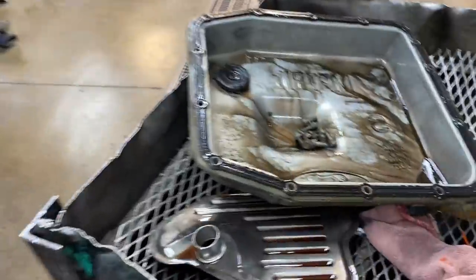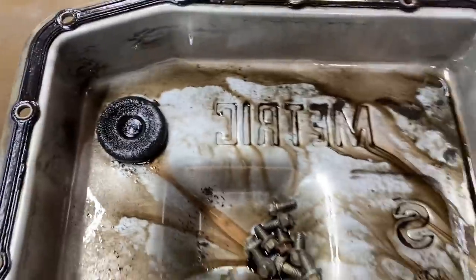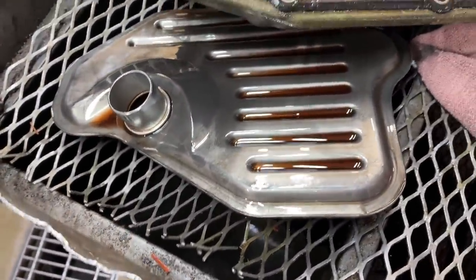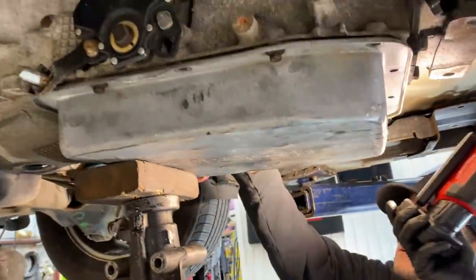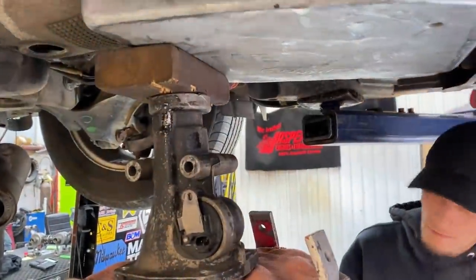You can look in the pan on this one — the magnet's about twice the size it should be, a lot of material, and this thing stinks. What we do is pull the four-wheel drive filter off, leave it off, and put a flat two-wheel drive pan on the vehicle so we can get it on our jack. It'll be flat — we just set it right on there and it won't have that tilting back and forth with the deep pan.